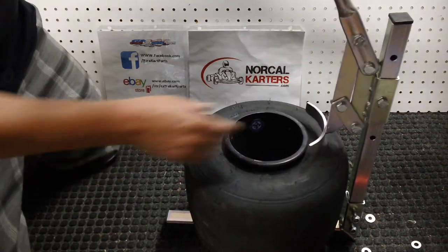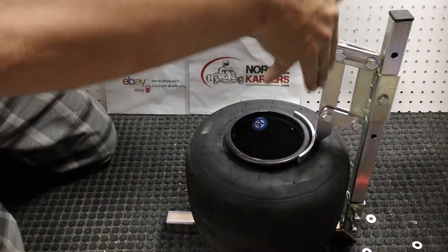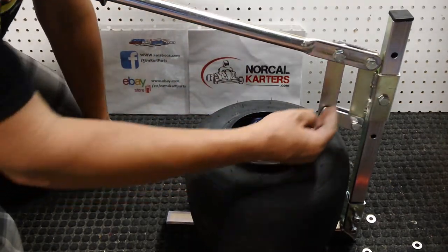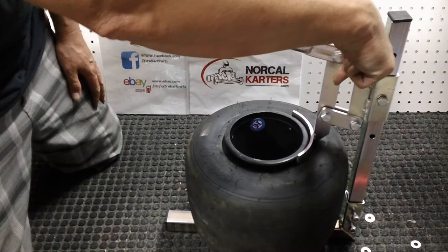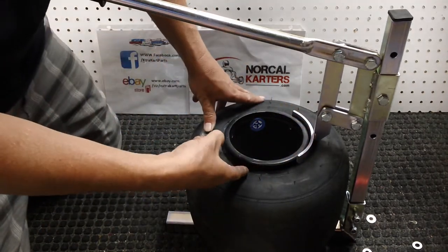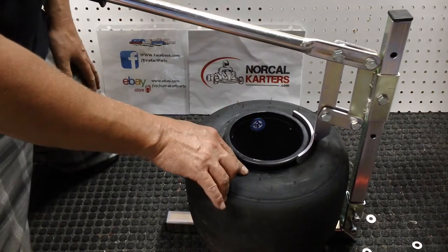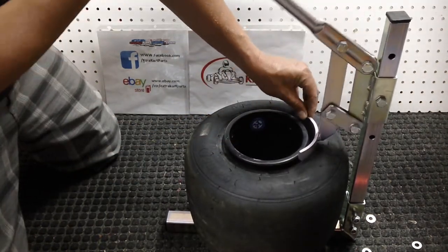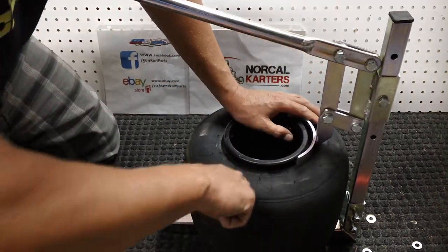The reason I like this model is that as it actuates up and down, it pushes almost straight down on the tire. There are other versions out there — they're all very similar — but another version just hangs off of one pivot point. As you change the angle of the lever bar, it has a small narrow foot for breaking the bead, and what happens is those tend to want to slip on the tire and dig into your rim. If you're damaging the rim, there's a high chance it will not seal and will cause you a problem. That's why I like this one — with the multiple levers, it allows basically a straight-down effort onto the tire itself without the risk of slipping and digging into your rim.